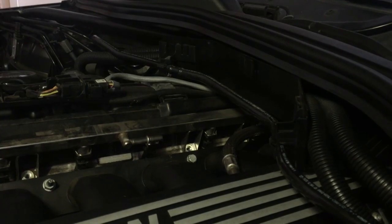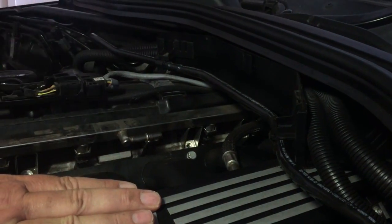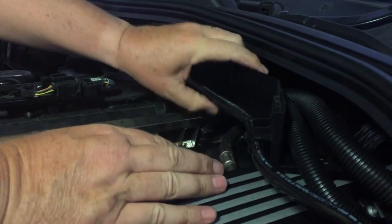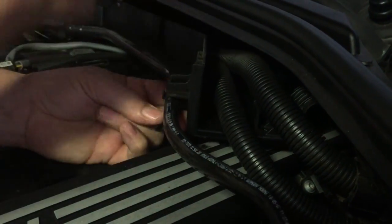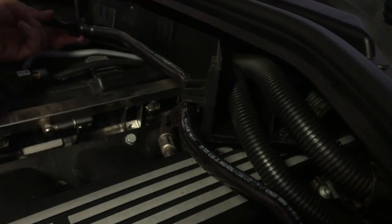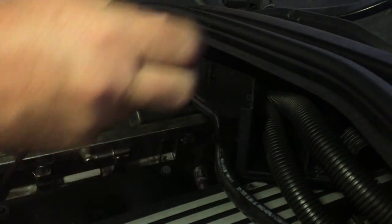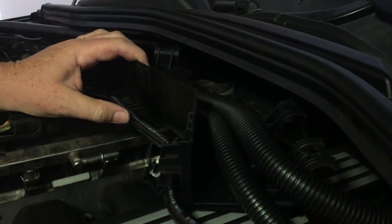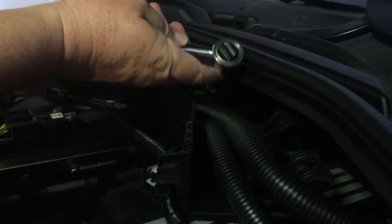Okay, so this last bolt is in underneath, but this part here, there's another part of the cover. Again, that's in the video, so have a look at my video about the coil packs for how to get the cover off. This part here actually just clips forward like that. So we'll just take this clip off. That comes off. Then this one over here comes off. Then we'll lift that out and bring this over the top. That'll give us just a bit more space. And then we just need to get onto that last bolt if we can.